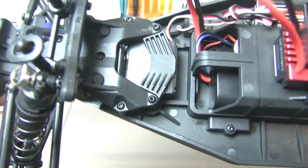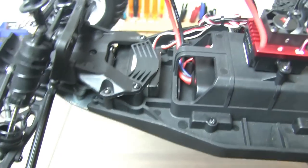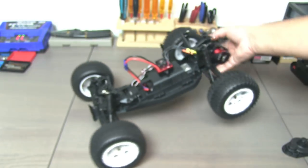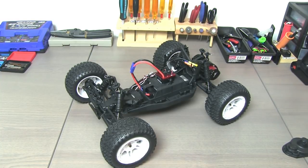The steering servo, buried down in there, is a Spektrum S606, which doesn't actually have a listing at the Horizon Hobby website — if you look it up by part number you'll get a different servo, probably an S615 or similar. It's about a 65-ounce-inch servo with plastic gears, so pretty basic ready-to-run stuff. It should work just fine in the truck — this is not a slow-speed trail vehicle where you need a ton of servo torque. Even with a 2S battery you're going 30 miles an hour, so the servo doesn't have to do a ton of work. You can always upgrade it later.